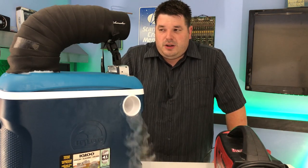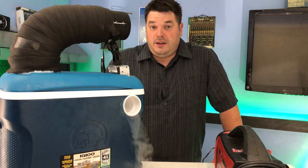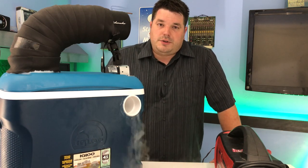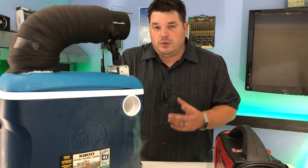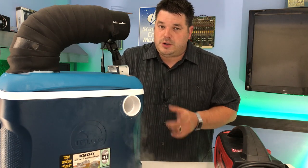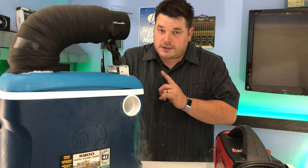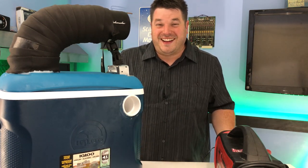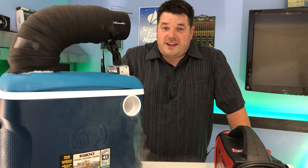So this is pretty awesome. Would I recommend dry ice in these things to use? Not like this. I do have another idea that may work better — an indirect heat exchange. In other words, I would not be blowing the air right across the dry ice, so I would not be introducing all the CO2 into the air. It may also not produce as much moisture. The dry ice might actually work better if we don't cool the air down so far, because then we're not drawing all the BTUs and it'll stay solid longer, as well as not ice up as quickly. So I may revisit this in the future.